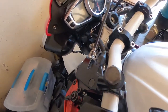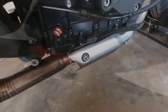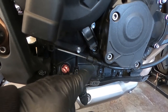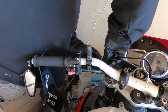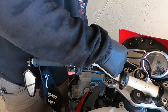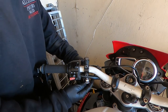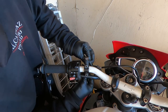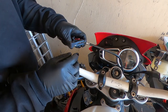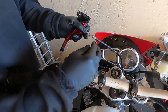In order to get the clutch case off, we're going to need to slacken the clutch cable. You can either do that at the lever at the minor adjustment or down below at the major adjustment underneath the case cover. I chose to slacken the cable at the lever, but this will require you to remove the lever in order to get enough slack down below. Most levers can be disassembled the same way: first by loosening the bolt underneath, then removing the bolt, and then removing the pin. With the lever removed from the bike, you're able to remove the cable from the lever, which will give you enough slack down below to remove it from its housing.